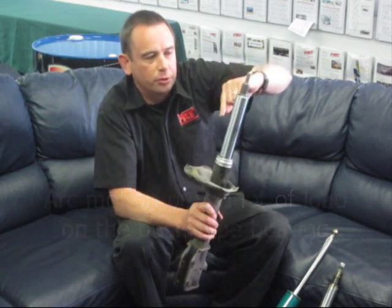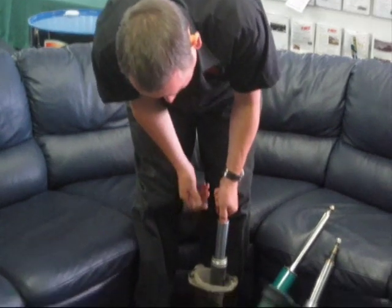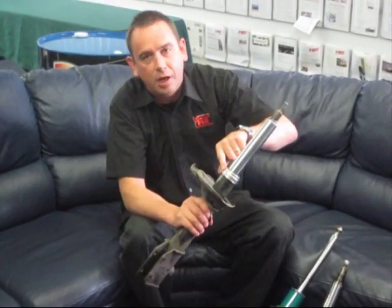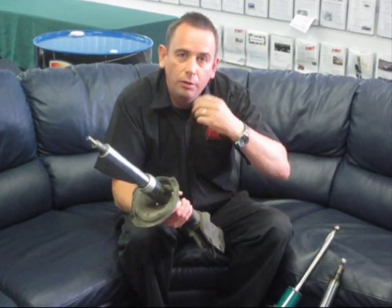If you've got an older Subaru and you come up to a set of traffic lights and stop, it almost feels like someone slightly nudges you in the rear suspension. You might not know what it is, but you'll think something moved in the back of the car. What's happening is the suspension comes to a stop and then moves up a little — it's actually sticking in the bush because the shock absorber's outer bushes are worn out.